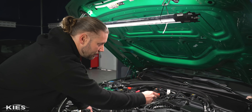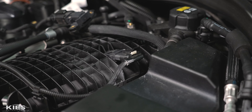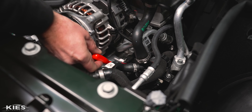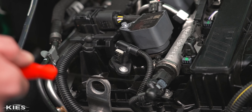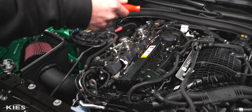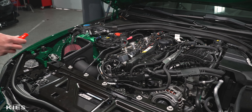What we need to do is tap into this sensor over here, which registers the intake pressures. Then down here is our boost pressure sensor — I actually painted it white with a chalk marker so you guys could see it more easily. Then we have our camshaft positioning sensor, and right over here we have the sensor that controls our fuel rail. So we'll start at the top: intake, then boost, then camshaft, then the fuel rail.